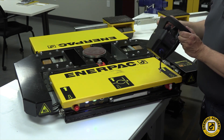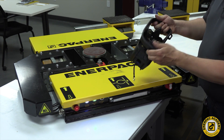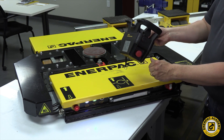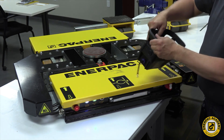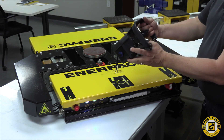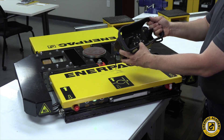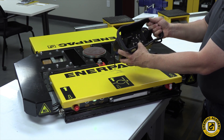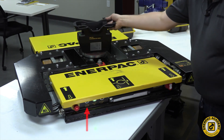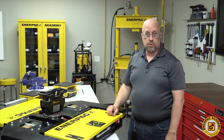To turn on the wireless controller, turn the blue switch 90 degrees clockwise. On the opposite side of the controller is an emergency stop — turn and rotate this 90 degrees clockwise to reset it. Finally, press and hold the start button for 2 to 3 seconds. You'll see the LED on the left-hand side of the controller start to flash slowly, indicating that the controller is communicating properly with the E-Mover. You'll also notice that the blue light on the E-Mover has turned off, and that completes the controller setup.